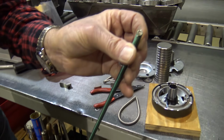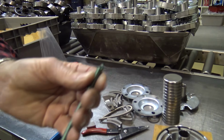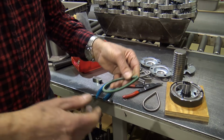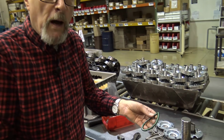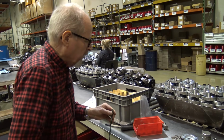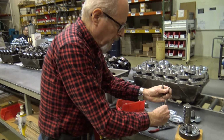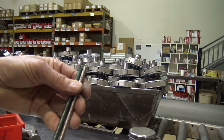There it is. It's closed, and it was easy to pinch out, and I didn't mark. So now I can put this spring together, put it in here, and that engagement, well, this is a green spring. This is a 2,500 engagement on this spring. Now with that, I don't know how many loops. I'll go see how short it is compared to a typical spring. Well, here's a typical spring. It's the same length. So I'm going to cut out,